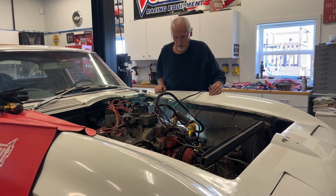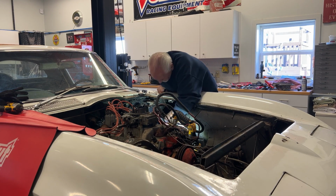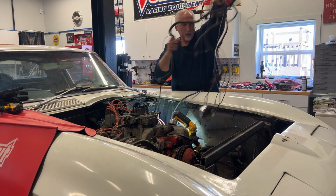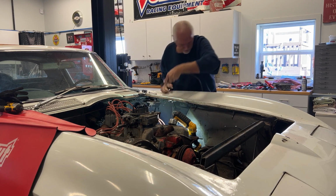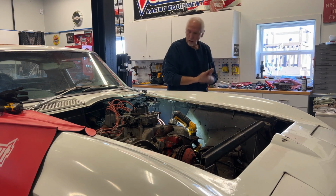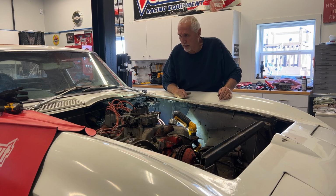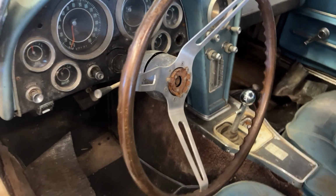Like I got the wiring harness on hook. Let's see if we can disconnect it here from the dash. There's the headlights, and then there's the engine one. Let's see if we got this on here. Ready to go. There you go. See if we can get this headlight one out of here. Yep, here's the headlight one. So we get all the wiring harnesses from the firewall forward out. Looks like I gotta do a couple more things: remove the steering column, disconnect it, get it out of the way, and disconnect the master cylinder, and that's about it.